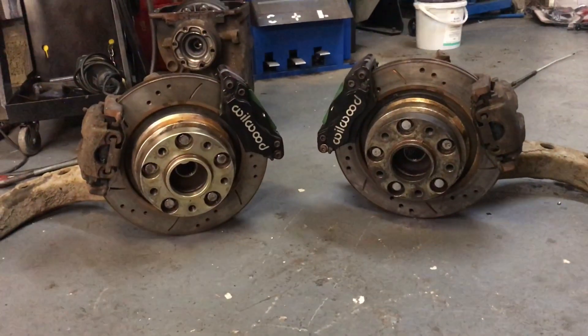There she is - double calipers on, looking sexy! Big thank you to Richard at Northeast Brakes, can't fault his work. I just gave him my hub, he kept it about a week max and made the brackets, put it all together - done, quite painless. Now if I run semi-slicks or anything wide, that should lock the brakes no bother. The other benefit is when you're on the foot brake and pull the hydro, it doesn't lift the foot brake at the same time - it's totally separate plumbing. Happy with that - like and subscribe, see you later.